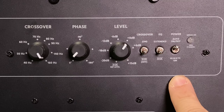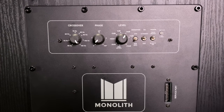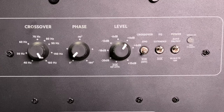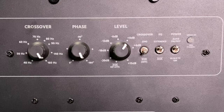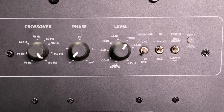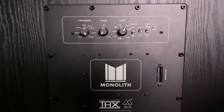Next is extended mode. You can put it in extended mode if you like — plug the foam port in the front, and it'll give you a little more sealed performance and dig a little deeper on frequencies below 20 Hz. Regarding phase again: once you've got the subwoofer in a good position and you're still not getting great performance, I'd highly recommend that two-person method — have someone wiggle the phase knob while you're in your main listening position. If things are out of phase, it'll completely drop the low-frequency effects and almost sound like it's not even on, because you get noise cancellation when two waves meet.